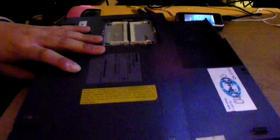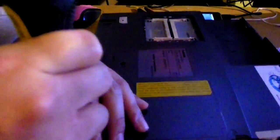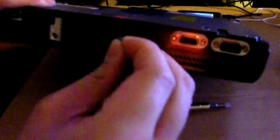This is an old Toshiba Satellite Pro 4200. This laptop used to belong to my brother years ago and he apparently forgot about it. Since then he has more modern computers. I had already taken out the battery, the RAM, an expansion card left in one of the slots, and the keyboard. I also took out the hard drive, which works and is accessible after putting it inside an enclosure. Judging from the contents, the computer used a version of Windows NT pre-2000 or XP, but not 95 or 98. It has a capacity of only 5.59 gigabytes after formatting — extremely small by today's standards.